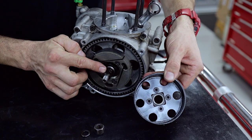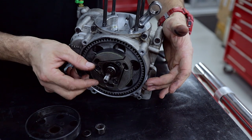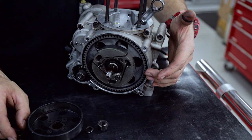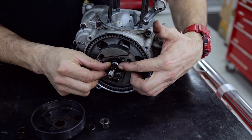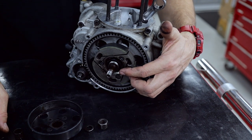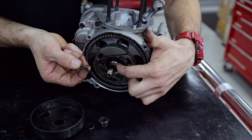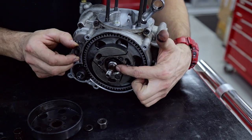You can see this one here is a little bit dirty — probably could have been greased a bit more. That's the clutch drum, needle roller bearing, then you've got your little o-ring, and then the internal thrust washer. Now it does have a beveled edge here and that's to marry up with the slight radius in the crankshaft.